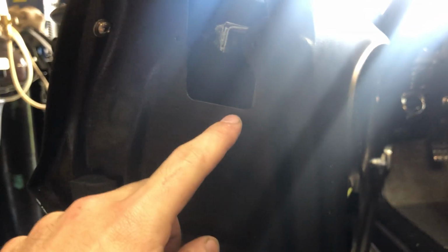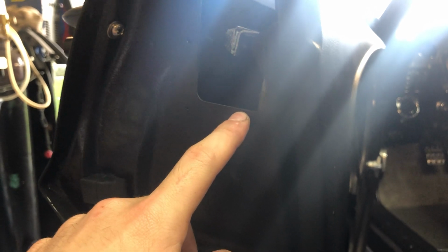I'm gonna see if I can feed my drill into the hole to drill out so I at least have a starting spot. If not, I'm just gonna take my caliper on the other side and get a rough depth and drill a small pilot hole and then burr from there. Yeah, that's my fun.